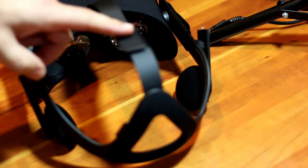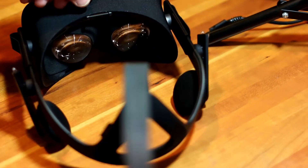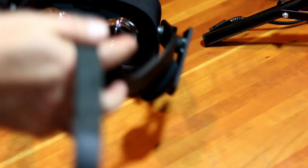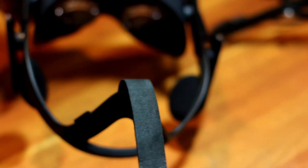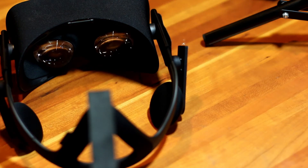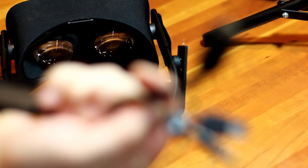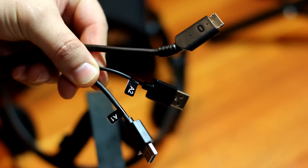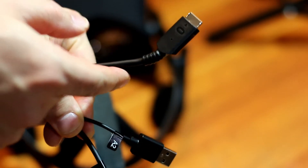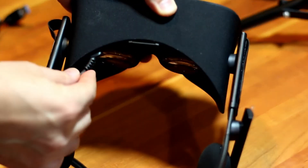Next, remove the top of the headpiece strap by undoing the Velcro, sliding it through, and releasing it. A tip: this is a good time to clean the lenses on the Oculus because you have easy access without the strap or eyepiece in the way. After those are clean, go ahead and attach the TP-Cast cable. You'll notice there are two ends — one end has cables labeled A and B, and the other side has cables labeled A1 and A2 along with the data cable. Take the data cable end and plug it into your headset where the original cable was, going over the top of the headset, and it snaps into place.